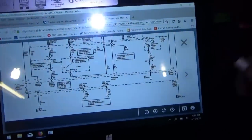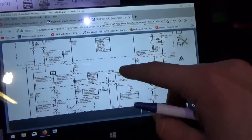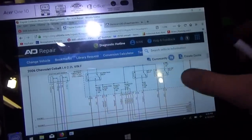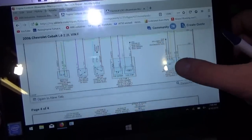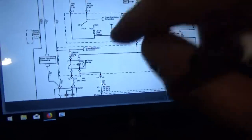Here's a wiring diagram — the first page is the engine control module OEM diagram. Let's pick a direction: since stuff doesn't work, let's focus on how to make the starter crank over. We'll pull up a colored Mitchell diagram and find the starter powertrain relay. You might wonder why we didn't plug in a scanner right away — let's just chase this starter circuit. Should be on a relay — a couple easy checks and we'll go from there.